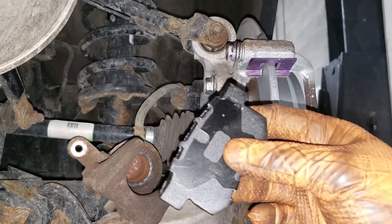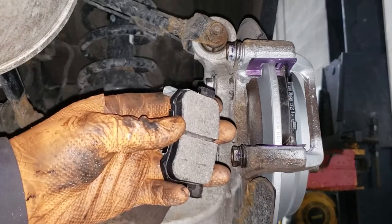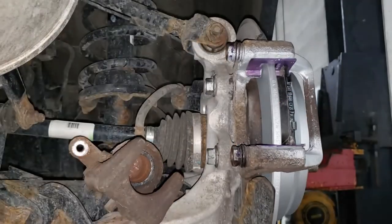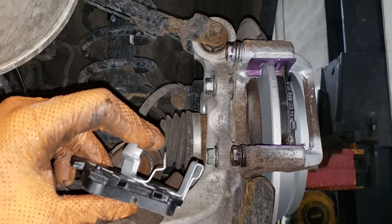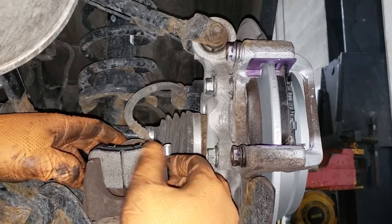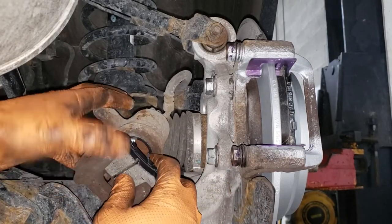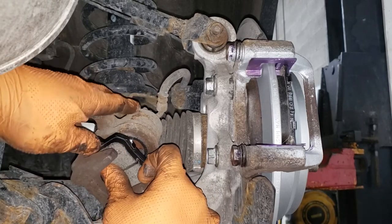Okay. Take your outer pad, place it on the outside portion of your caliper bracket. Take your inside pad and what's left of your gloves and whatever strength you may have in your hands, and try to force this thing into the piston. Remember, boys and girls, if you start to see red or feel like you're about to pass out, take a break and try again. Once you get the three tabs in, push with all your strength using your core, lower back.